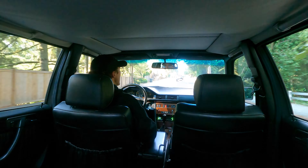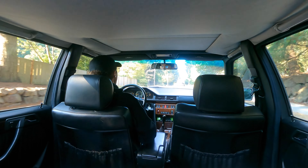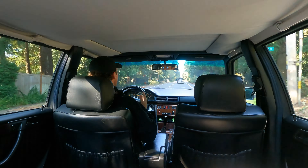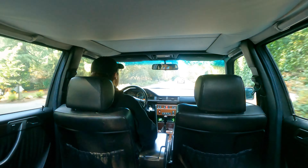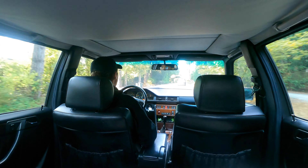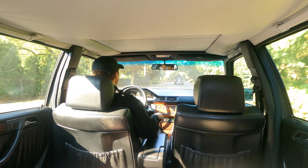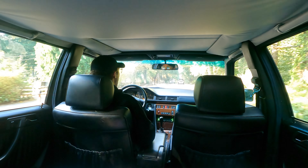This is definitely a momentum car more so than anything, because it's not powerful enough to just launch you, but it really wakes up in the higher RPMs — which is different than most Mercedes V8s, and that's mostly due to the differential ratio. Down the line, another modification I'd love to do is find a 300 diff that would fit in, because those have a slightly higher ratio that would lend itself better to the manual and the V8.